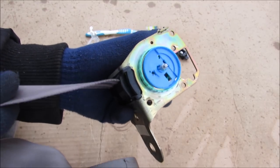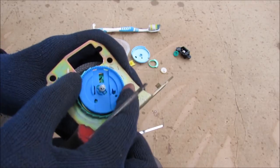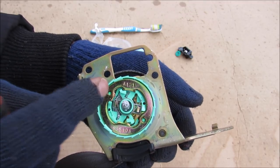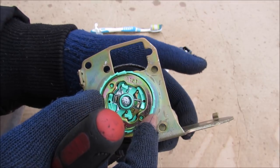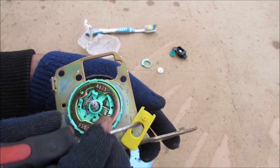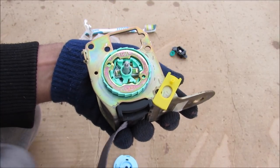With all these components removed we still have the mechanism on the inside that allows the seat belt to lock when you pull it really quickly. The yellow slider had a little notch that when it moves back and forth inside, it activates a spring-loaded tooth inside. Now I'll remove this blue gear, and then we have the green spline shaft. This here is the retractor tooth — you can see there's about 10 degrees of free play. This spring keeps tension to hold this unlocked. If moved in one direction the retractor is unlocked and allows you to pull the seat belt; in the other position the seat belt is locked. The slider's tooth engages and disengages that lock, allowing the retractor to unlock for the first few inches — controlled by this cam — so you can get the seat belt on before it starts to lock up again.